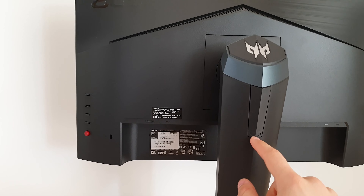You can see with in-game examples that towards the top of the screen there's a lot less distinct detail, whereas further down the screen the same elements appear more distinct — porous rock textures aren't as clear towards the top. However, this model doesn't have the same kind of gamma shifts as some TN models. Larger TN panels and even some 24-inch models have more pronounced shifts, but this 24.5-inch panel is more moderate — the shifts are still there but less extreme.